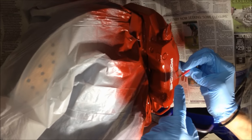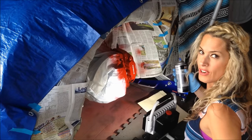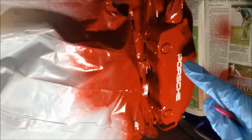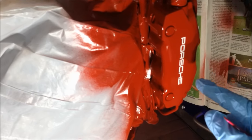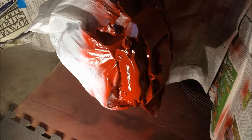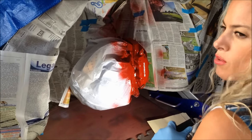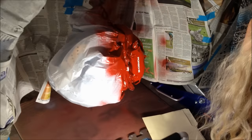Go real slow, just relax, take a breath. I got my letters on. Do not be alarmed if when you peel off your letters you can see a little indentation of where the sticker used to be — just press and get those little corners in. Everything looks fabulous right now. Now I'm just going to start clear coating right over this — get that area really well, get the whole thing. Three coats of this, ten minutes in between, and seriously, you're done. Then I'll show you the final product after we're all done.